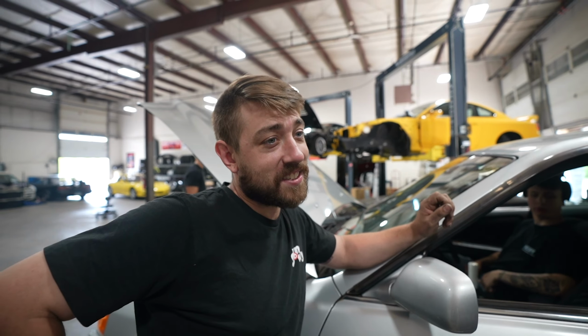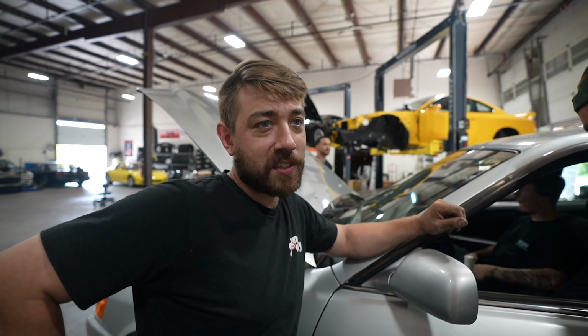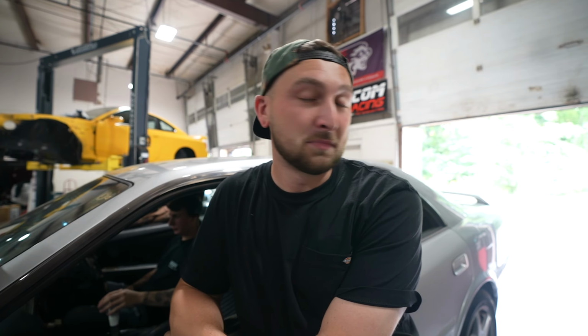Wow. Not bad. What do you think? I mean, it looks pretty sick. It sounds insane. I'm sure it'd be awesome to drive. That was 15 PSI ramping up to 18. Seems pretty good to me. Our buddy Jay has the exact same turbo setup, and he made about 500 horsepower, about 20 PSI on a Mustang dyno. So it seems pretty spot on to me.